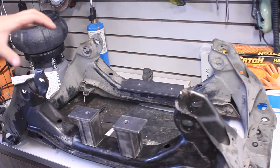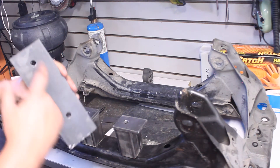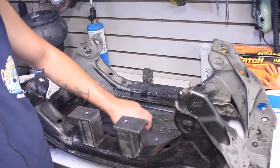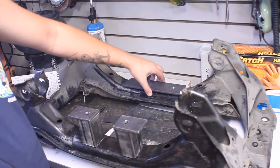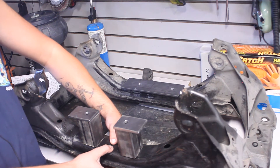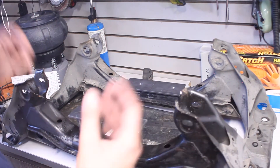Another thing I'm not sure was intended this way when this design was created - the probably intended use was to put nuts on the back of this and have them in there. But I'm going to go above and beyond: I'm going to make a nice hole here and here, drill holes that line up on top, and do another plate on top. That way when I bolt everything together it'll be nice long bolts basically sandwiching everything together around the subframe, not just attached to this plate and pulling on the welds. That should make it stronger and less likely to have the diff fall out.